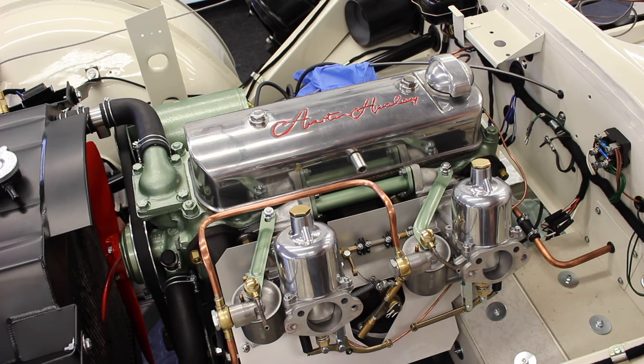Now we need to have a little listen to our exhaust note. There are three types. Too weak is an irregular note, a splashy misfire and colourless. Correct is a regular and even note, and too rich is a regular or rhythmic misfire.